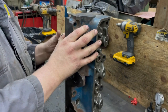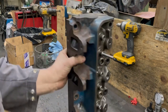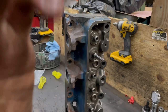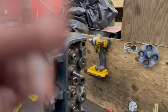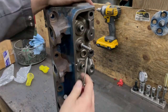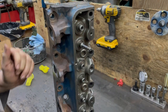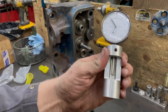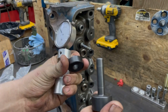If you slide your valve in all the way, your installed stem height is the height from where your spring sits to the tip of the valve. I don't remember off the top of my head what these ones were — one of the guys was working on them. This is the gauge we use for checking it, and this is the setup tool. That's an inch and a half; if you're doing two-inch ones, you pull it off and check the two-inch.